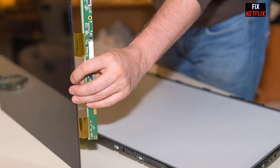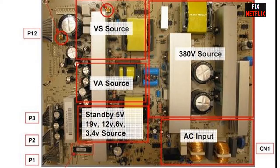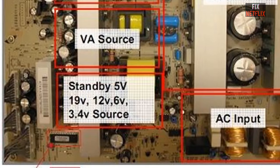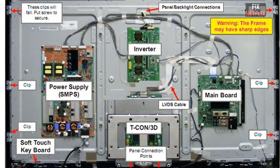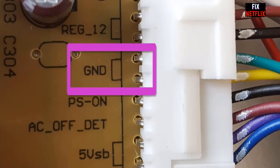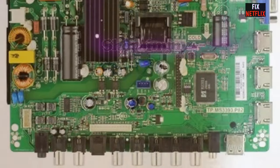The first common fault of the LCD or LED TV mainboard is: TV no power, front indicator light off, no sound, no display. First, check whether the PSU has voltage output. If there is totally no voltage output, disconnect the connector from the mainboard and check whether the PSU standby voltage — 3.3V or 5V — appears. If no standby voltage output, it is the PSU board problem, not the mainboard.